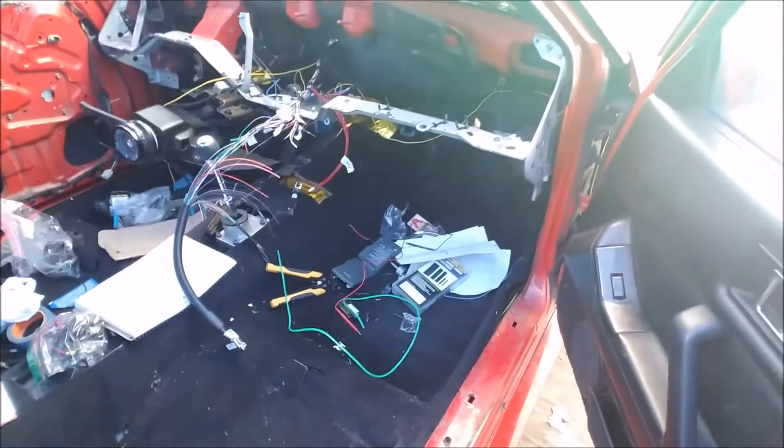He's just blocking off those ports because they didn't have any plugs - all they had was SAE, no metric. We're going to try to get the rest of this wired up. We got to run power wire to the back, wire in some sort of switch setup, do relays for the fuel pump and starter - those are the big ones to try and start it.